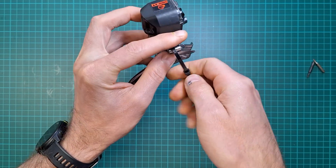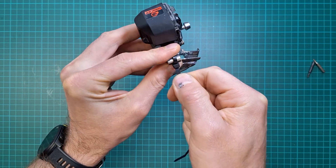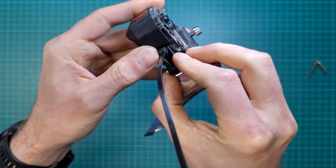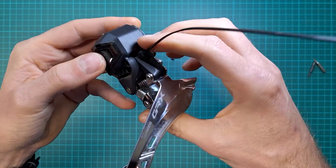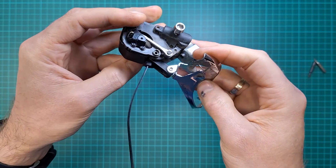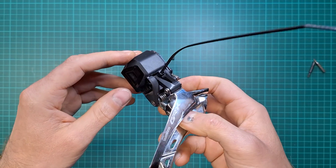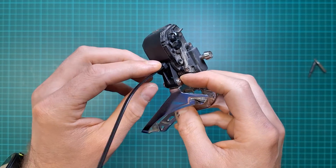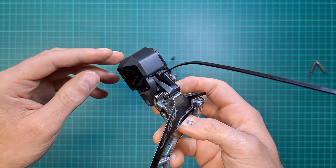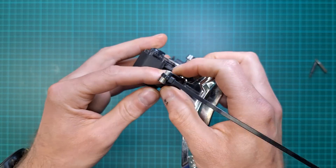You don't have to remove everything if you're at the roadside. Cable ties can be found in hardware stores or sometimes even in the supermarket. If you clamp it like that, it's going to get you home without any issues — make sure the clip is all the way down. So if you're roadside without front shifting and you've got some climbing to get home, that's definitely the way to go. I've heard stories of that zip tie hack being used for months, even years.